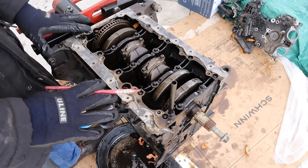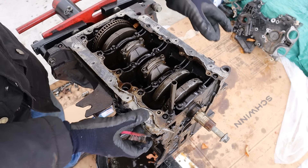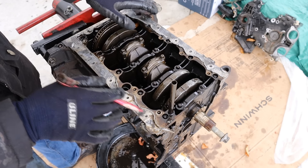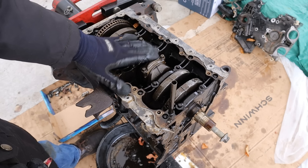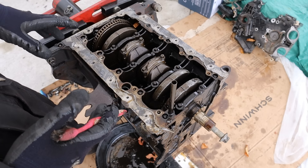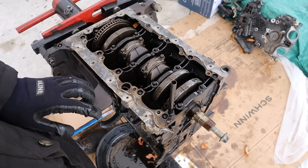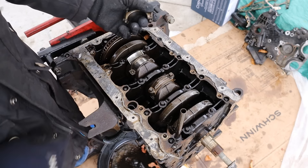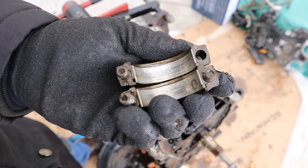Now this engine by design uses a pretty strong bottom end. It is a turbocharged engine and it does have an iron block, but moreover it has this ladder frame-like design where this upper oil pan piece, which is bolted to the block, incorporates the main bearing caps. So it's kind of like one piece holding the crankshaft together. That means that while your crankshaft might be safe — in this case it is — the rest of the block and the piston is probably going to blow. Surprisingly, their connecting rods are actually pretty tiny and they're only held on by two E10s. The connecting rod bearings also fared quite some damage. I think the coolant was run through the system for a little too long.